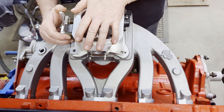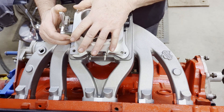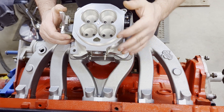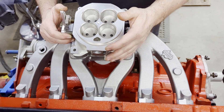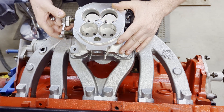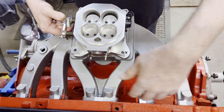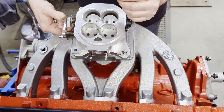Hello from Gill Welding and Fabrication. We've got an item here we'd like to show you — the throttle body orientation problem that people sometimes have without realizing it. When you open up the primaries in this position, you have equal distribution across the manifold, and this is basically what we like to do for slant sixes.